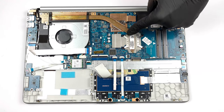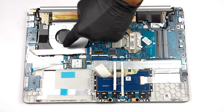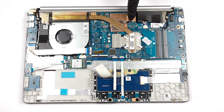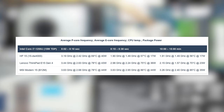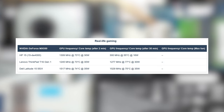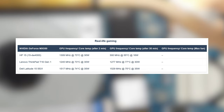The HP 15 has only one heat pipe. In simple words, it isn't suitable for heavy loads like video editing or anything more than casual photo editing. The CPU shows its muscles in the first seconds of 100% load but after that its clock speed drops significantly. Gamers shouldn't consider this model either, since the GPU lowers its clock to just 300 megahertz after 30 minutes of gaming. Still, temperatures are really low, but at what cost?